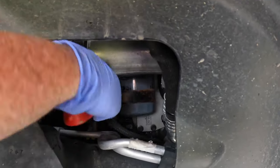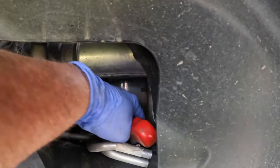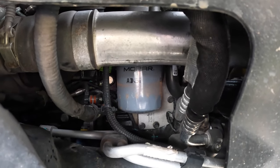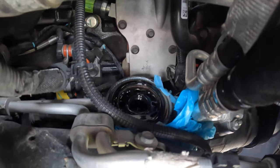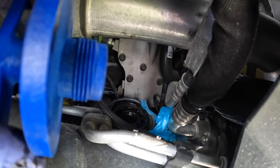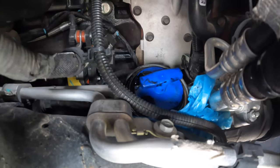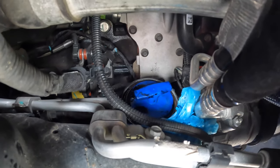We'll get this to where it's really loose, and I can just turn it by hand — it feels like it's there now. So we will get this oil filter wrench off and get it out. I'm going to get a plastic bag and work it down around that oil filter, just in case something spills. There's a little shelf down there that I stuck it on just to hold it. I got the plug worked on there — did it by one hand, you can't get two in there. So I got it in there as tight as I could with one hand. Going to wrap it with that plastic bag and pull it out. Got to turn it horizontal to get it out.